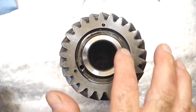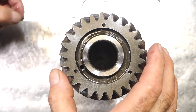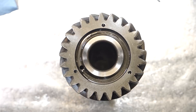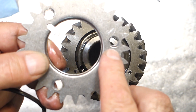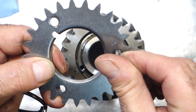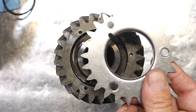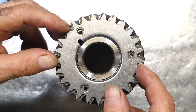Once the plate is removed, you can see you have the three holes where the rivets were. A lot of older replacement counter gears actually had these holes in them and this machined area for the plate to register. But with new counter gears, we don't use these plates anymore. Without the spring in place, you can see that the hole is much bigger than the rivet, so the plate floats within the rivet. That is why eventually the plate cuts into the rivet and shears it. The spring keeps the plate loaded away from the teeth.